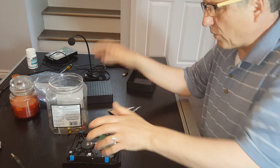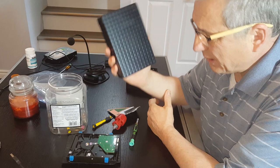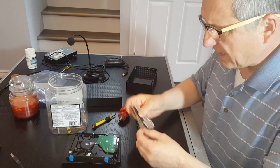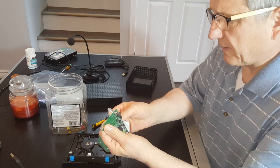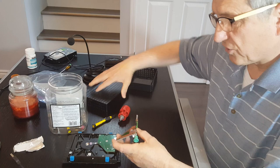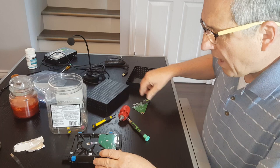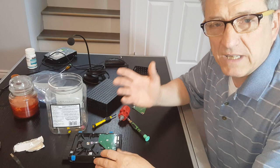So I worked on it and found the answer by opening up the hard drive — something you're not meant to do, but at this point I couldn't retrieve any information off it. I went to Memory Express and bought exactly the same hard drive so I could take the electronics out of one and put it in the other. I exchanged the reader component first and tried it out, but still couldn't get anything to work.